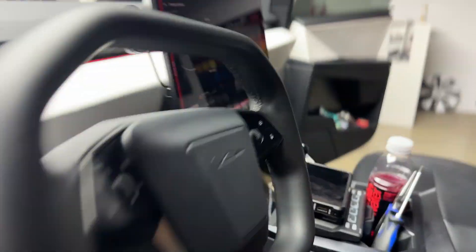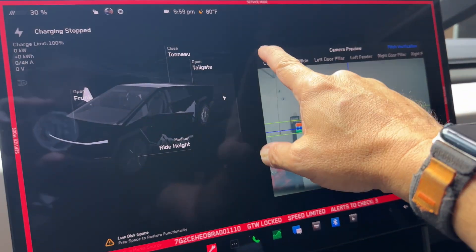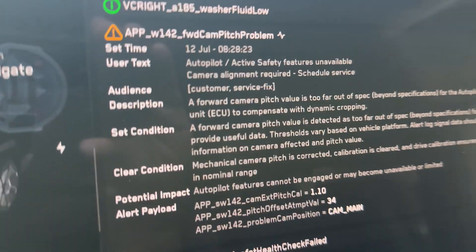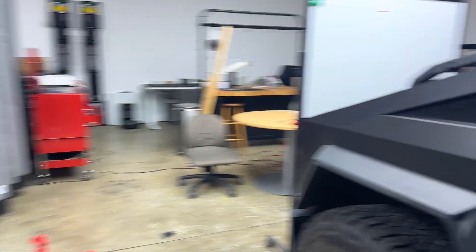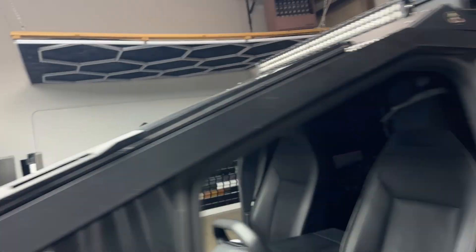The reason why I'm going to do it myself is because I'm on a road trip. To confirm the issue, you have to put a marking that sits at exactly 165 centimeters from the ground. You can do this with tape or whatever. You have to put a flat surface in front of the vehicle, kind of centered so that the cameras can look at it.